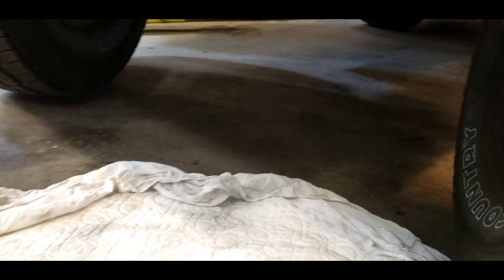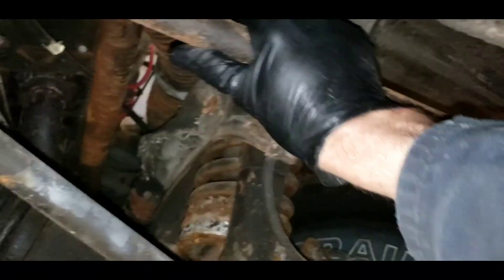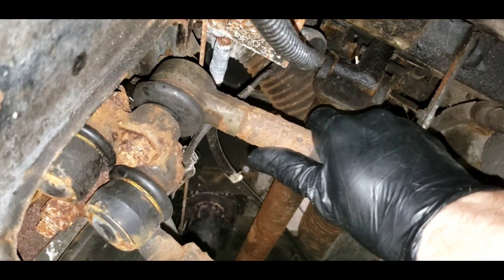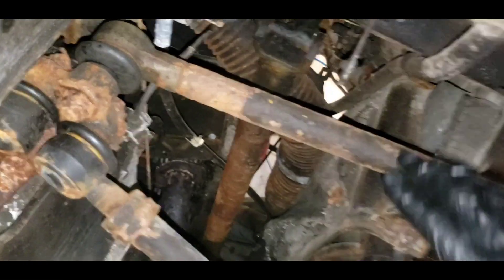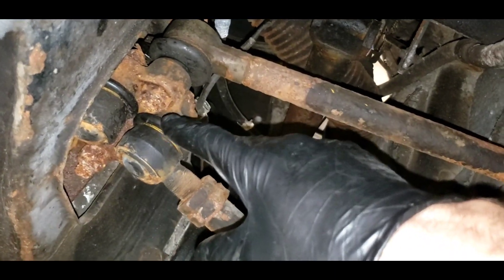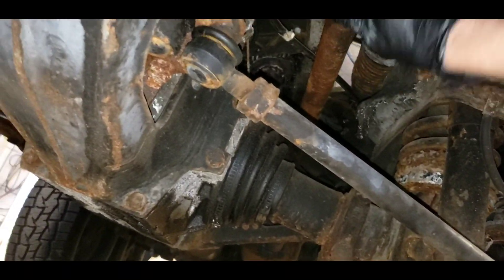The reason for that is this — we're going to get technical now. I'm going to lay down here and show you this drag link, which comes from the steering box right here. You can see the play in that. You're turning the steering wheel, it's moving this drag link which goes to a trunnion and moves each of the tie rod ends. It's completely worn out.